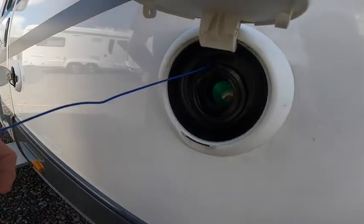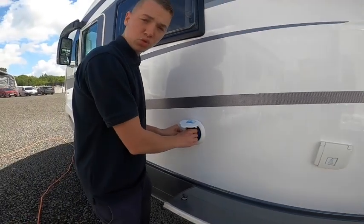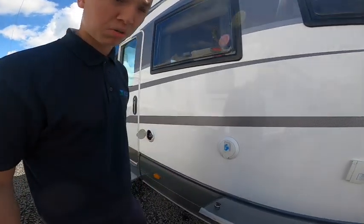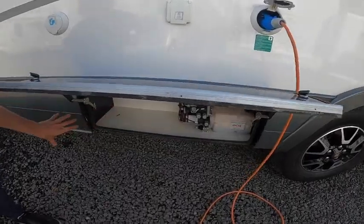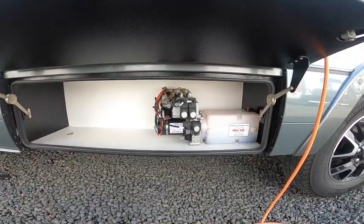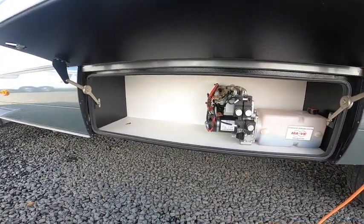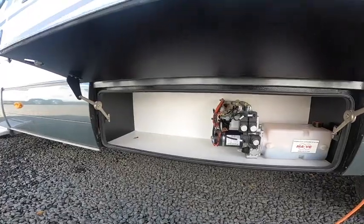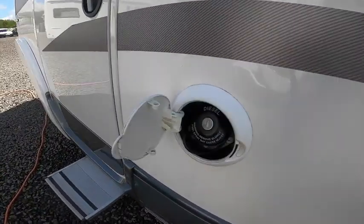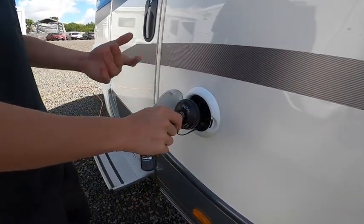The fresh water filler is here — to fill the fresh water tank, which is underneath your dinette seat, put a hose pipe into there. Make sure you carry a hose with connections as it's mainly just a brass tap on site, and fill until it overflows or until you're happy you have enough water on board. There's some storage underneath but it is taken up by the hydraulic leveling system tank — that's the motor and hydraulic oil tank, so keep an eye on that and have us top it up at servicing. Here is your diesel filler — use the fiat key, pop it in, then put the diesel nozzle in and fill with fuel.